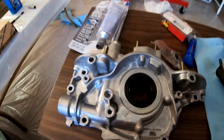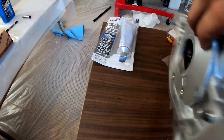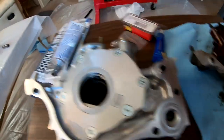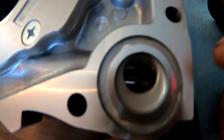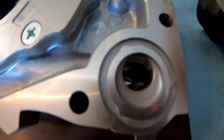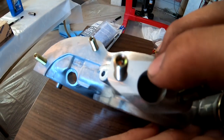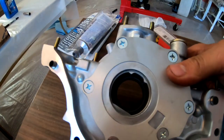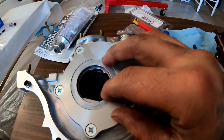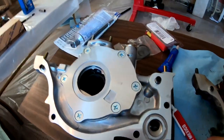Basically there's different ways how you could increase the oil pressure. One of the ways is to drill this out all the way — you can see that hole was drilled up here, also drilled out. Another way to increase the oil flow is to drill this bigger also. The only bad part about drilling those two is that you're going to end up with shavings inside, so you've got to pretty much try to open this and clean everything as best as you can.